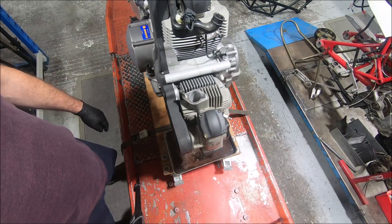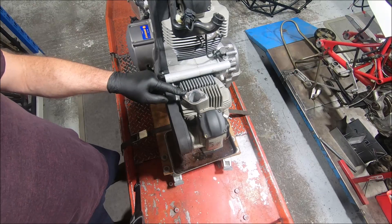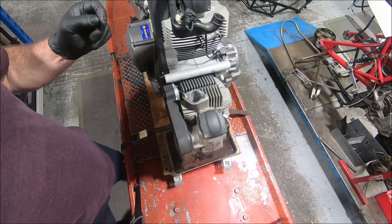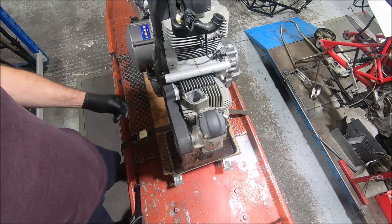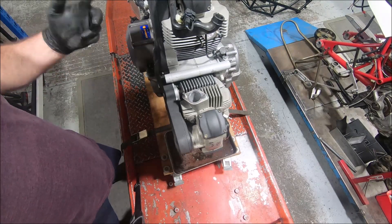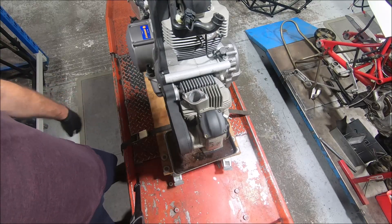Today I want to pull the horizontal head off - probably the easiest one to get off - and just look at whether we can put these cylinders and heads, which I'll call the DS style two-valve cylinder and head, because it's like the original thousand DS head as opposed to the traditional head, onto the earlier cylinders and vice versa. I think the reason you can't is primarily the oil feed, but we'll look at that as we go.